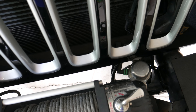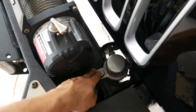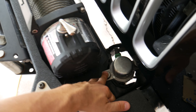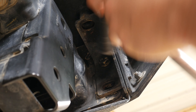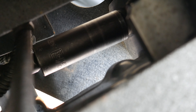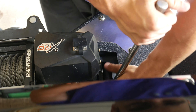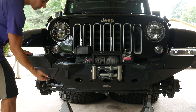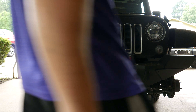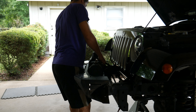I think we're going to mount mine right here, so we won't have to mark off anything. But if we did have to mark off where the edge of the bumper was with the winch, we might want to tape that off before removing it. Removing the bumper is super simple. There are four bolts on the back — stock they are 18 millimeter nuts, but on my setup they're 19 millimeter, a combination of bolts and nuts. My bumper is a little more labor intensive since it has a modular design, but still not too hard to get off.